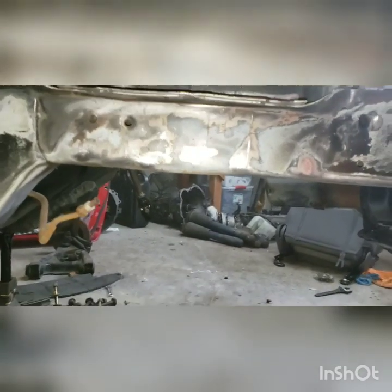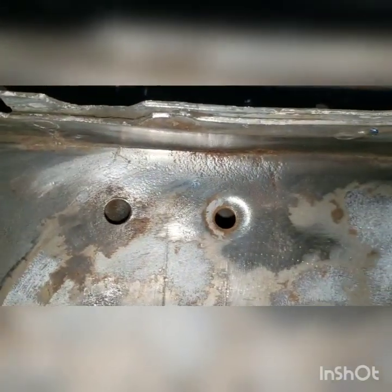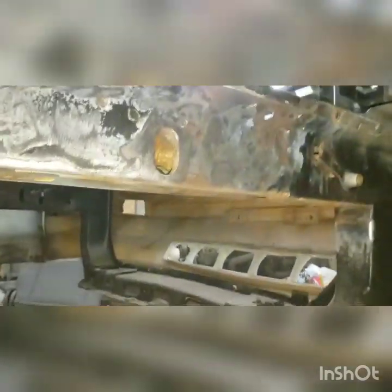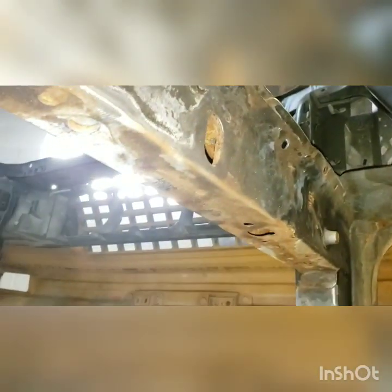The new wire wheel really just cuts away at this. A little rust dust I'm not too concerned with — I'm going to clean this off before I paint it with Purple Power, and then we're going to go over this with Chassis Saver. This side was a lot better at the shock tower, but down here on this rail was a lot worse. It is dirty and rusty inside of there — still need to take care of some of this. The underside was pretty trashed.